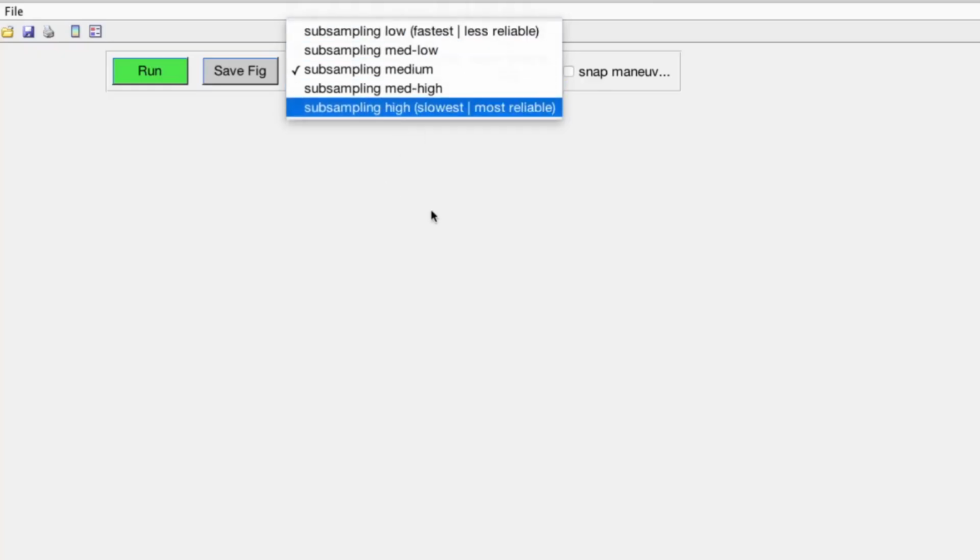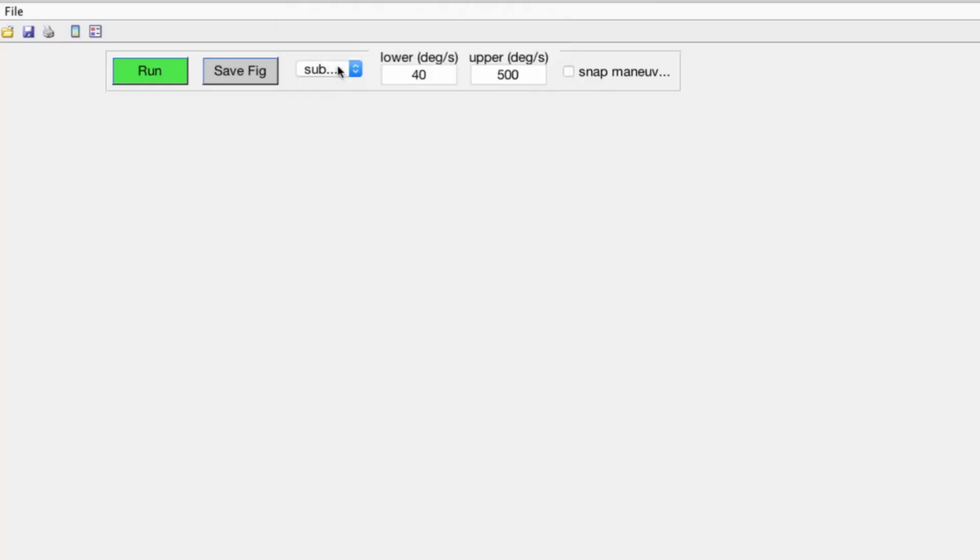Because in the past, I tried to get as many samples as possible. So like 4.5 minutes. That's about the log size. Then the log is full, 8 megabyte. So this is not really necessary. I'm getting ahead of myself, but in the software, you can set the subsampling to a higher level, and it'll sample at much finer resolution. So it'll extract every bit of data that it can out of the log file, and it doesn't take much.